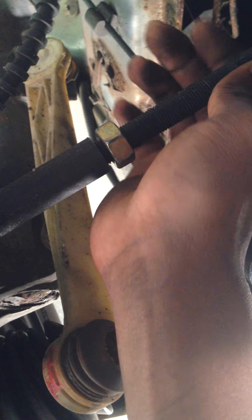That is really all you do — you don't have to pay a thing. Once you get that, tighten it until you feel like it's right. Then tighten this back and make sure it's really tight. Take off the jack stands and the jack. Go for a drive and see — if it's still slightly to the left, come back, loosen this again, twist a little more inward. Keep doing that until you hit the sweet spot.